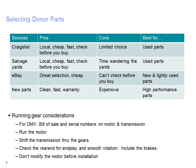Again, that was one of my risks. I was worried that it wouldn't start. I picked an EFI motor. So by ensuring that was a known good part, I knew the motor was good. I knew I had to put an aftermarket ECU and harness on it. So if I know the motor's good, then if I had a problem starting it, I know it's something else and it's not the motor. So it's a matter of just reducing the variables you need to troubleshoot if you have a problem. Fortunately, mine started on the first twist of the key, so I was very happy about that.